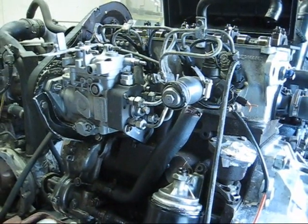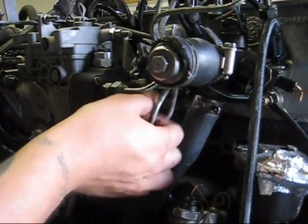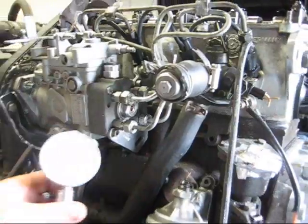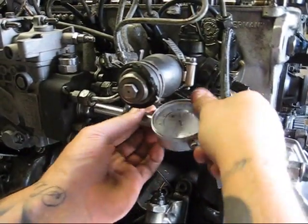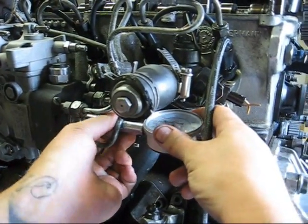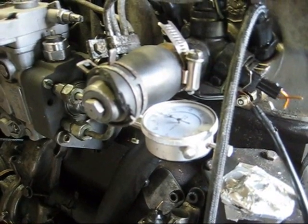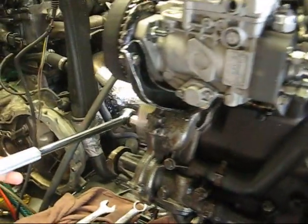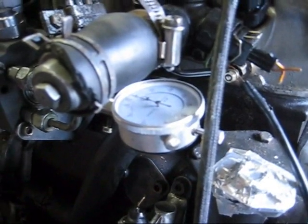You're ready to put in your timing gauge to actually set the correct pump timing. You'll see that there's a timing plug back here that unscrews. With that out, you have a dial indicator with an adapter that screws in. When you have the dial indicator in, you want to put a socket on the crank gear and turn the crank in the opposite rotation of what the engine would normally do.